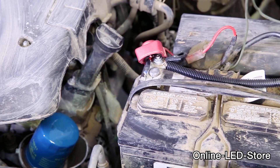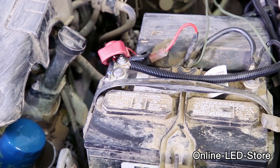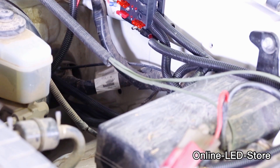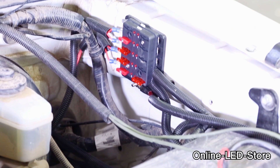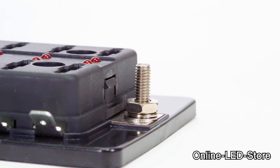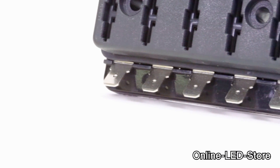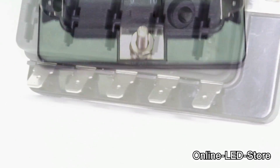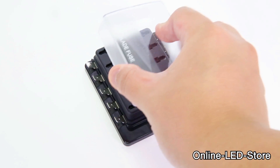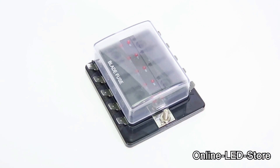Okay, let's get started. Both fuse box models are interchangeable with power source ranging from 10 to 32 volt DC. Compact and rugged, the LED illuminated red indicator light allows you to quickly diagnose which fuse has popped. The fuse panel on both fuse boxes is fitted with a quarter inch stud for power feed. The unit's quarter inch male quick disconnect terminals can handle 30 amp per circuit with a maximum of 100 amp per panel. Both fuse boxes are equipped with a clear cover for additional protection.